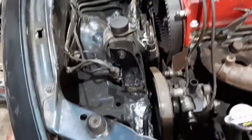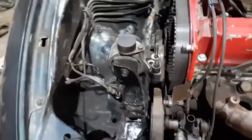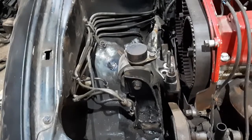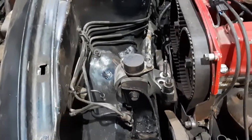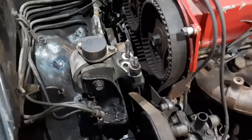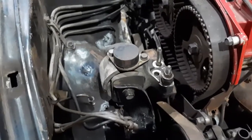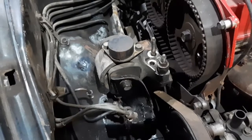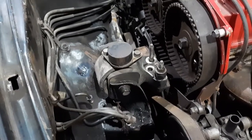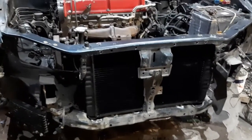The engine is mounted really close to the frame rail, so we have to fabricate a new bracket for the stock Hyundai Tiburon engine support. It matches up pretty nicely to the 4G63 — two of the three holes line up, so I have to remove the other stud. I think it should be rigid enough to handle the weight and forces of this engine.